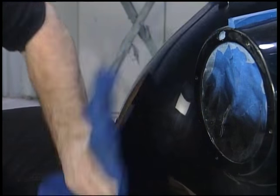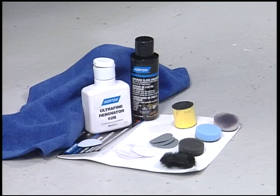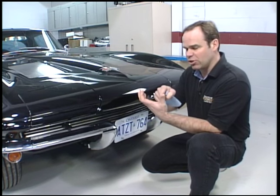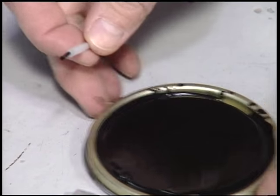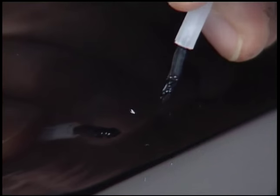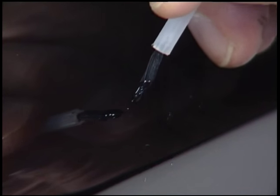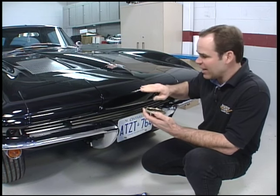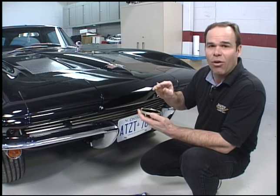How does that help you at home? Norton's got a system for small touch-ups for you to do yourself. There is a spot repair you can do at home. Like any chip, what we have to do is fill that chip with paint. So fill that little valley where the stone's taken out until it's level with paint. Start with a small touch-up brush, paint on a tin. It might require a few applications to get the touch-up paint built up above and beyond the existing paint. Make sure you let it dry, because if you start to sand that touch-up paint while it's still a little bit sticky or spongy, it's going to rip it right out of the hole again.